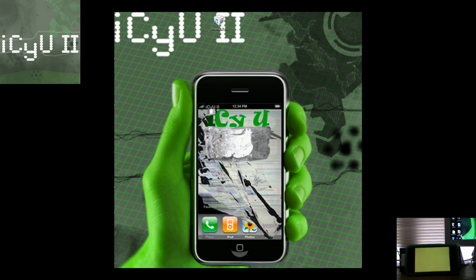Hey YouTube, it's IcyU2 here. Yesterday I showed you guys how to get 4.0 GM on your iPhone or iPod Touch, and today I'm going to show you how to downgrade back to 3.1.3, or really any firmware that's still supported by Apple. As of now, this should work for the iPhone 3GS, the iPod Touch third generation, and the MC model of the iPod Touch second generation — but don't quote me on that. Today is the 9th of June and I don't think Apple has stopped supporting firmware 3.1.3 for new boot ROM devices.